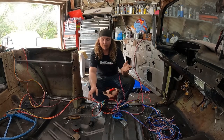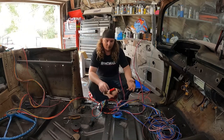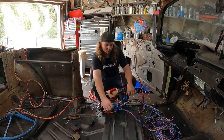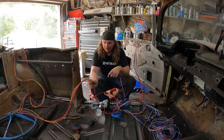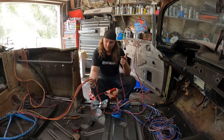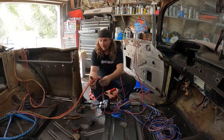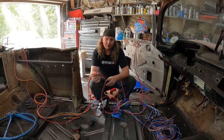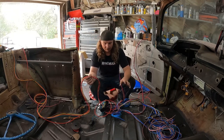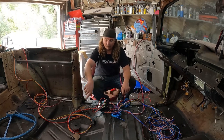This spaghetti mess is organized. We're going to have our fuse panel which will be under the dash, obviously. These ones here are looped off — these are the return for the senders and stuff like that that we're currently not going to use, but may. At the back we have taillights and stuff. With these kits you've got to be creative — they're only going to run back brake lights, left and right turn, and park lights. You've got to make sure your park lights are also your license plate lights, anything like that. I put in a thick 10-gauge wire for the fuel pump, running up by the fuse block for a relay.